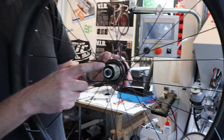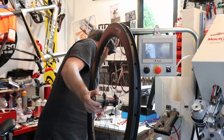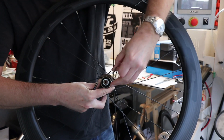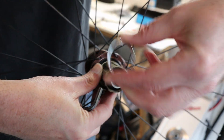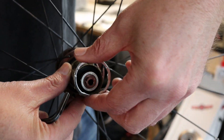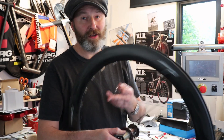That's it — you're ready to ride. All you need to do now is install your cassette. If you've got an 11-speed cassette it goes directly on. If you've got a 10-speed cassette, you just need to install this spacing converter on your freehub first before installing your cassette. It's splined and fits on in several positions. Install that before a 10, 9, or 8-speed cassette. If you're riding 11-speed, install your cassette directly. That's it — you're ready to get on the road and enjoy your new fat boys. Thanks for watching, thanks for riding.